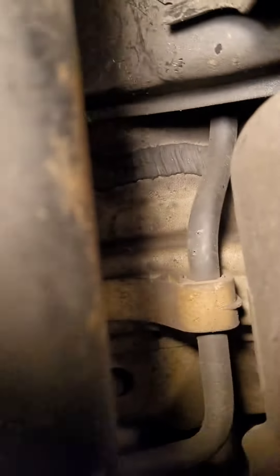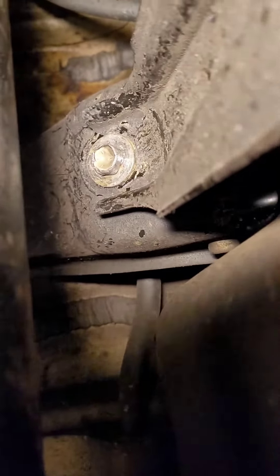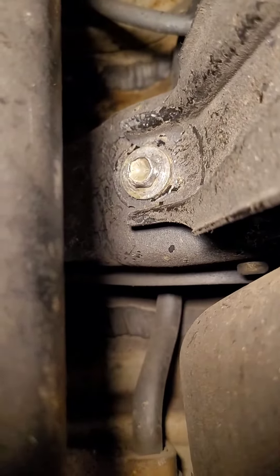This is the fuel tank skid plate, held by six bolts. You see that — one bolt up there, no problem. The other four on your side, no problem. But this one is really bad. This side, it's a 2003 — it's not accessible to this bolt at all.